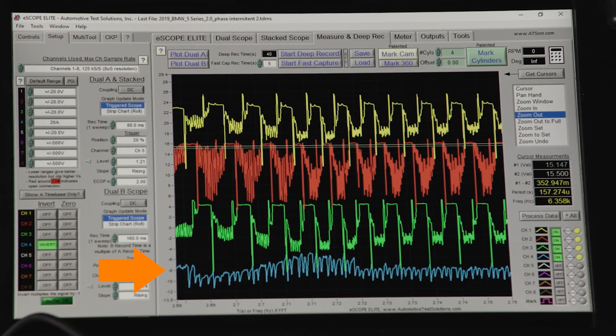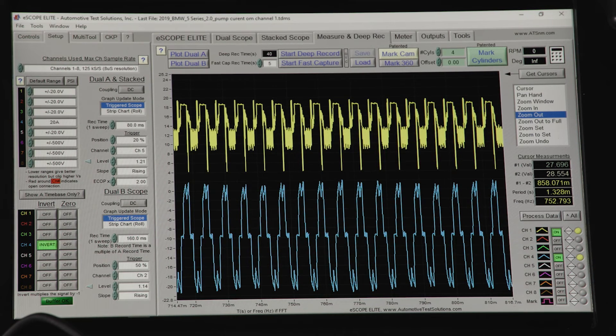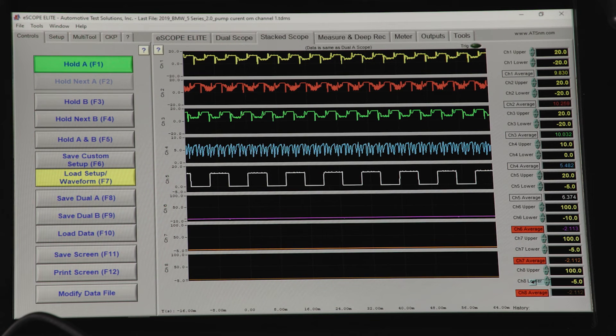At idle, the pump draw is displayed as 7 amps when connecting this way. You can view more precise current patterns by connecting your current probe to one of or all of the fuel pump phase wires. When connected this way, we can see a more detailed view of what is happening on the circuit. When voltage is high, current is positive at about 11 amps. When the phase output switches polarity, current goes negative to about 11 amps. Since I am not using a differential test probe, my scope is not displaying the phase polarity switch on channel 1. Viewing the waveforms stacked allows us to see each phase, current, and PWM signal without signal overlap.